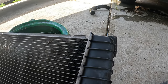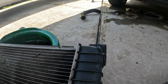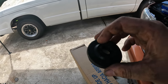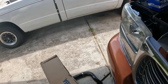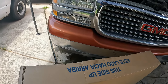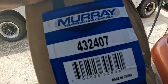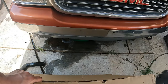Let me go grab the new one and I'll show y'all the part numbers for everything, then we'll start putting it back together. The rubber isolators are on the bottom of the radiator — if they stick to your old radiator, make sure you transfer them over to the new one. Here is the new radiator — it's a Murray, part number 43240-7.